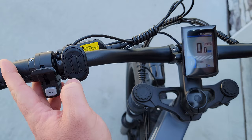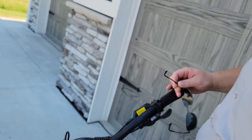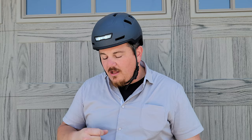Normal goes to about 500 watts, okay? Then, when you go to sport, it'll go all the way up to the full 1200 watts. You might as well never even use it in normal. It is a waste of time. If you want assist, and you want to save some power by helping mechanically as a human using your 150 watts or 200 watts that you can produce while pedaling under full strength, then that will help. The 1200 watt motor will help a lot.